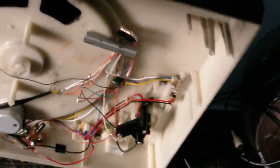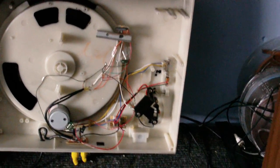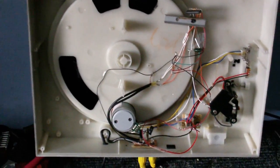If we take a look at the front, the label just fell off — it's lost its stickiness. But if we take a look underneath it, you may be able to notice some botch wiring here that I've done. In an earlier video, I actually tapped the original preamp board that this had and attached RCA output jacks to it, and also an external power wire.